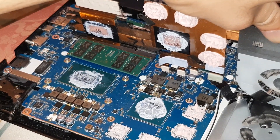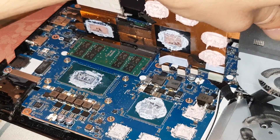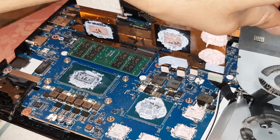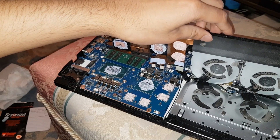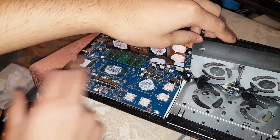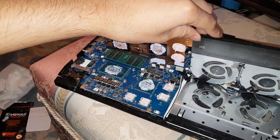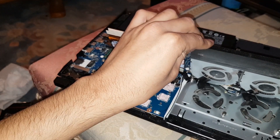What I'm going to use next is the Arctic MX-4, because that's what's been recommended to me — it doesn't do this pump-out. I'm also cleaning the dust off the fan. Watch out for my next video where I'll be repasting everything, including the VRMs, because last time I didn't do the VRMs and you can see how dry they are — that will help the temps a lot. Stay tuned and I'll see you guys next time, goodbye.